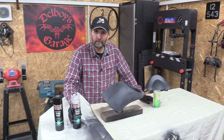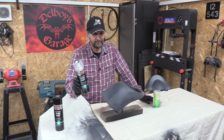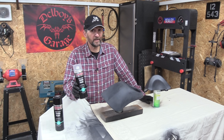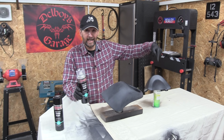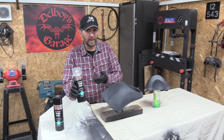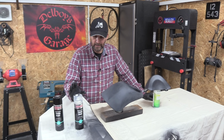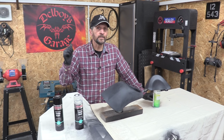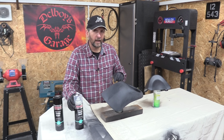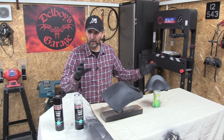Right, there's my two parts ready to paint. I'm gonna use the good old faithful gloss black tough paint. Yeah, I know everybody groans when I use this all the time, but I can't find anything else better for the job. The stone chips that you're gonna get on this little chin spoiler, that's the perfect paint for it. I'm not sponsored by these people. I pay about £6 a can for this and I just keep buying it because it just keeps working. Now, I'm gonna turn off the air conditioner, turn on the extractors, cover up everything vulnerable, put three wet coats on here, switch off the lights, walk out the door and give this 48 hours to dry before I can mount it on the bike.